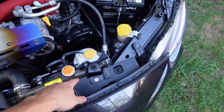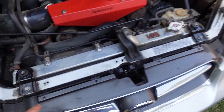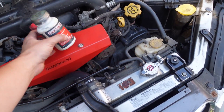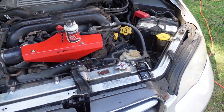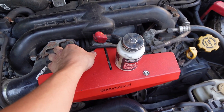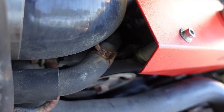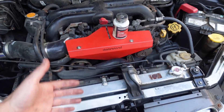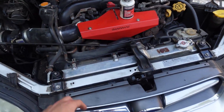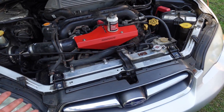I like it so much I might order another set for the Legacy. Over on the Legacy, I did manage to modify the STI ones to make them work — I had to bend the little tab on both sides, but it holds and now we have a cleaner look in the engine bay. I've got a place to put my anti-seize now, which matters living in Canada where rust is a thing. The cover does just touch the alternator, so I had to bend the bracket a bit and put an extra washer in there to raise that side. Overall I'm happy with it as-is.